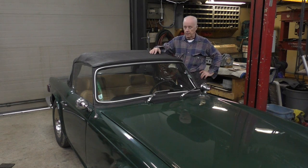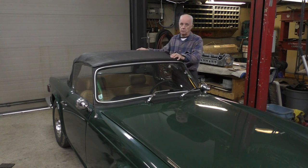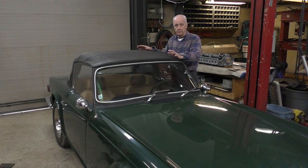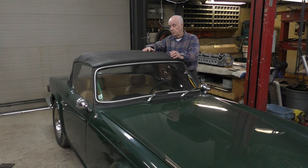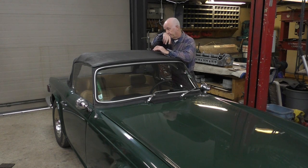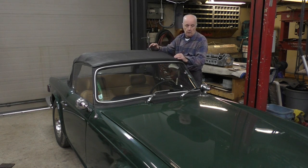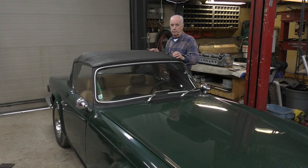I've finished the car — put all the interior back in and done everything. All I need to do now is take it to the paint shop to have the trunk lid repainted, because someone put a cover on it when it was wet and placed something on top, damaging the paint. Apart from that, everything's good. I drove the car with the steel wheels on — no clunks on the back and none of that weird vibration on the front either. The main thing is that with worn splined hubs, in extreme cases when you put the brakes on, the hub can actually turn inside the wheel, stripping all the splines off, and it can be very difficult to get the wheel off — I've had to cut them off with a welding torch before. But all the vibration went away.